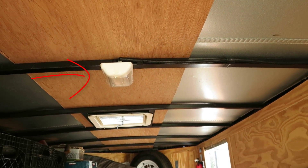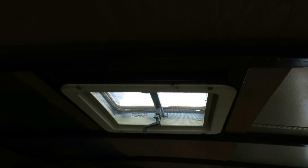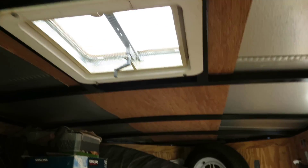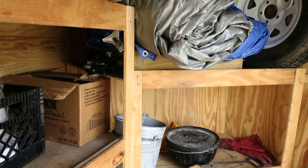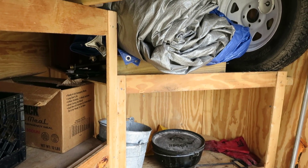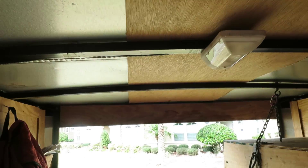Here's how the lighting is going to be installed. First off, this antiquated light up here — I don't think it ever worked. Over here there's a roof access where you can get airflow through the trailer; I'm going to use that as my access way for my solar panel. I'll run that lead down into this area where I'm going to mount my battery, my charger, my solar power center hub, and probably the USB multi-charger as well. From there I'm going to run a circuit out over to the two rails up in the ceiling for the LED light strips.